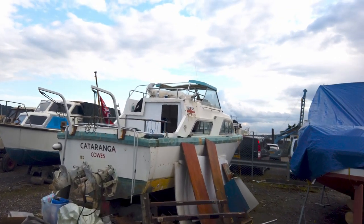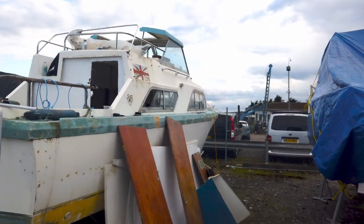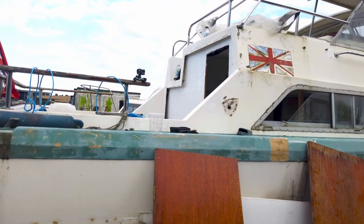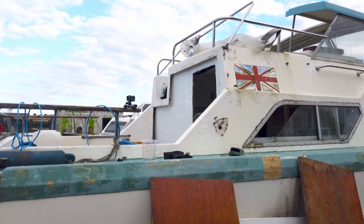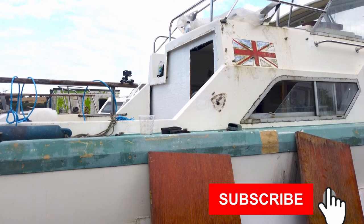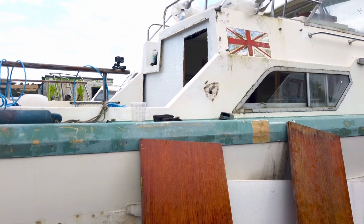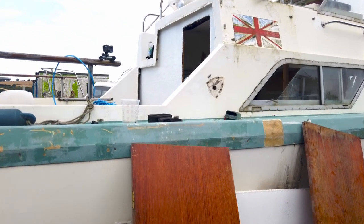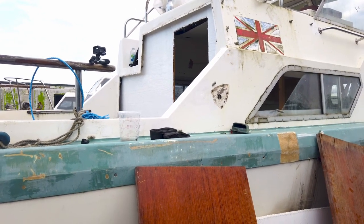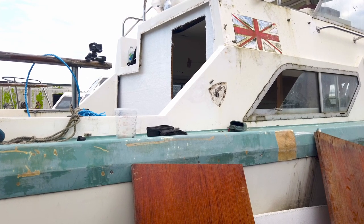Oh. Right, well, obviously it makes the rest of the boat look absolutely filthy, but it's definitely progress. It's definitely going to need filling and fairing, but I do have some hollow glass spheres on order. I'm going to have to add some more white gel coat to that order. And I think what I will probably do is do one more coat tomorrow, and then for the third coat mix in a load of spheres and basically use it as a fairing compound.